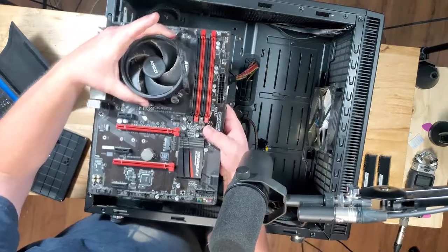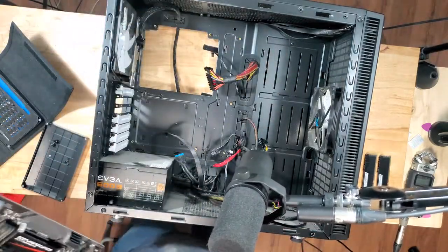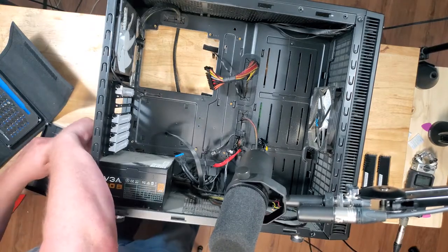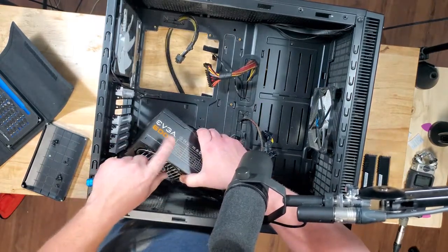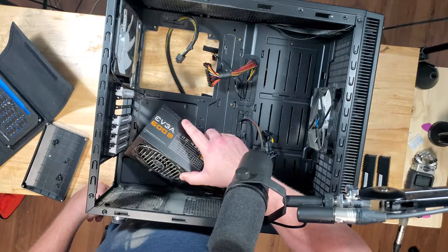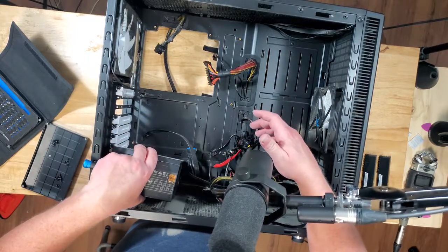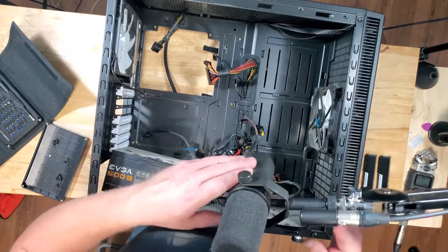Okay. There's the old board and it's looking a little worse for wear. It's a little dirty. This is one of the reasons I wanted to clean up — we're in a basement here and nothing stays clean. We're also going to take out the power supply. Now, this is something I didn't think was going to be a problem — this is just a 600 watt. I thought I had a 650, and that might be a bit of a problem going forward because I think you need a 650 minimum for the 3060. So we're going to see how it goes. I don't mind the concept of getting rid of all these ketchup and mustard cables, but I'd rather not be spending money on a brand new system right now. So let's get all these cables unrouted.